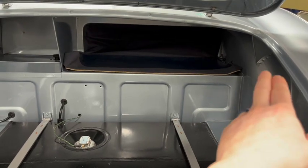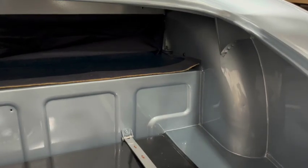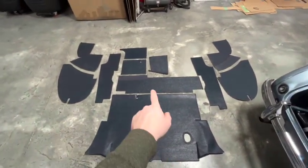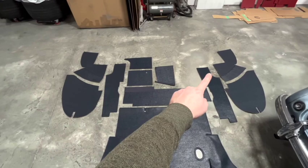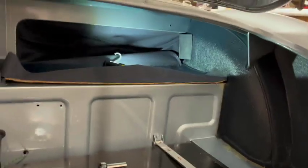I can put this wheel arch cover in pretty straightforwardly — it's got an undercut and goes all the way to the front. The spare wheel bag's piece of vinyl can be pulled under, and the wheel arch cover is a two-piece assembly that's sewn together. Looking at how these pieces orient in the boot: you've got the main mat and the upper bulkhead panel, then for trimming inside the box there's the floor and the back wall — a double piece that does both sides of that wall. First pieces to go in are the wheel arch covers, and then everything follows. I've got one side done with the wheel arch cover in, and I've also added the rear side panel piece that butts up and overlaps the wheel arch cover.